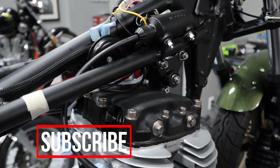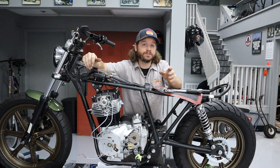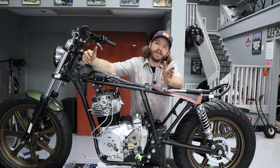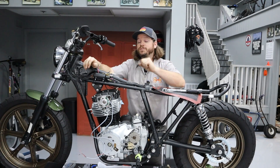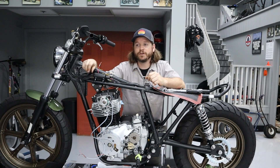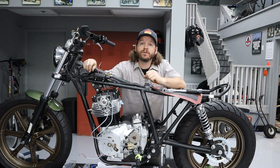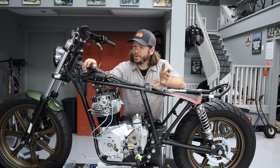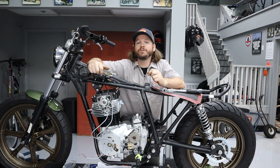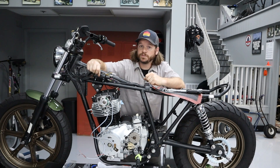Overall, very simple. The following steps after this would be to start the bike and get it timed correctly using a timing light, which is all outlined in the instructions provided by Mike's XS — check the description for that. We can't go that far because this bike isn't running yet, but hopefully soon. If you haven't seen the wiring harness episode before this, definitely check that out. Hopefully we'll have a first start video coming up soon — I still need to do the carburetors and button up a few loose ends, but we're in the home stretch. Hope you guys enjoyed this video and found it helpful. This was a tutorial on how to install a PAMCO system from an earlier XS400 onto a later XS400 that came with electronic ignition. Hope to see you in the next video — thanks for watching.